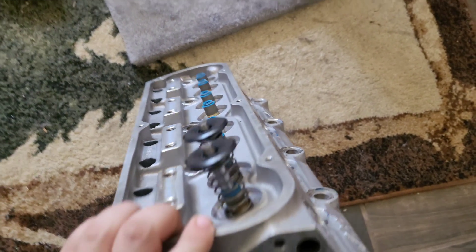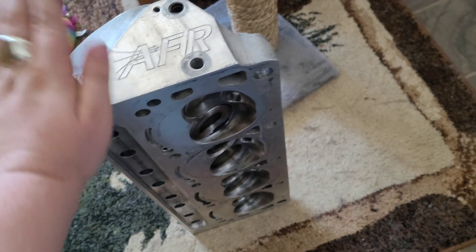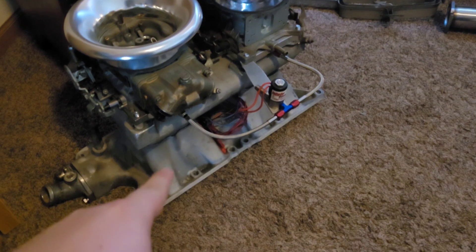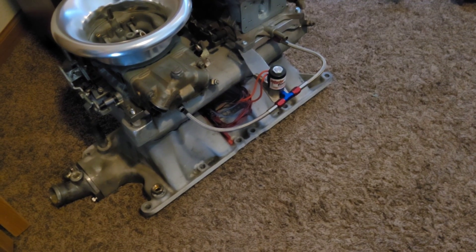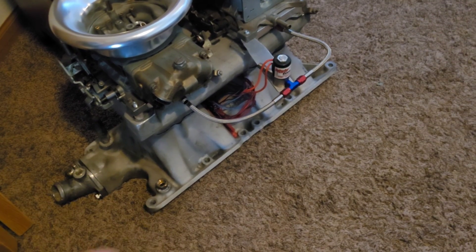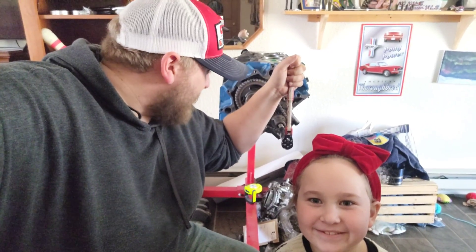After the second check with the 1.7 rockers, I just need to put these heads together and we're pretty much almost there in terms of getting it built. Good news - these tunnel ram ports are a nitrous tunnel ram. The actual ports on this intake line up pretty decently with the ports on the AFR heads. They're just slightly bigger in the corners because this is more of a square port where those are more of an oval port. We might be able to do a little bit of dimpling on the corners of the intake to create air eddies so it flows into the intake a little nicer.